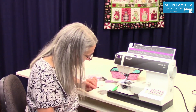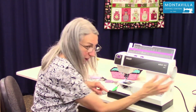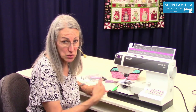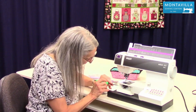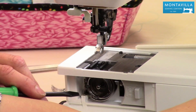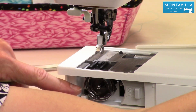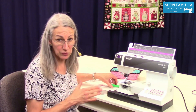Once you've got it cleaned, you might want to put a little oil every now and then — the book recommends one drop of oil every eight hours of actual sewing time. Right here you can see when I move this back and forth, part of it stays stationary and part of it moves. You want to have a little drop of oil right between the sliding places. One drop of oil is all you need, and make sure you're using good quality sewing machine oil only.